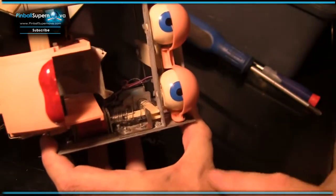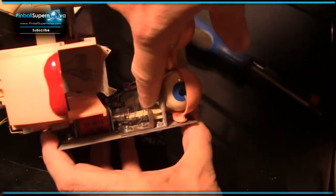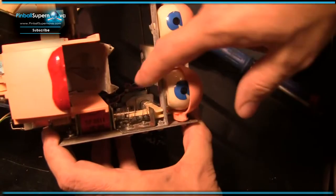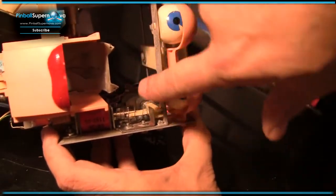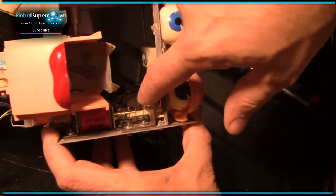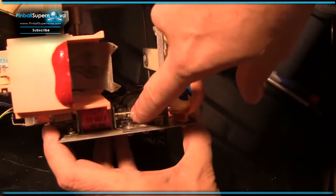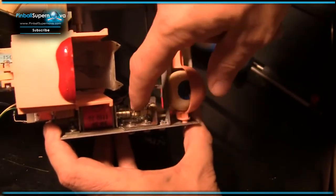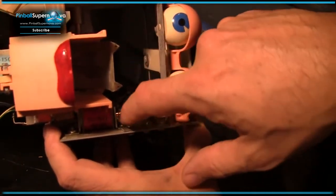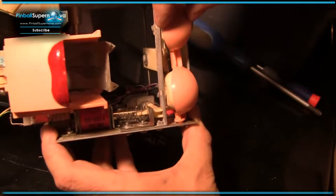And the reason, I think, is you see this spring right here? I think it's inverted. It's turned the wrong way. One end is wider than the other, and the narrow end is over here, and the wide end is over here. It should be the other way around. The wide end should be against the coil, and the tapered end should probably stop right here so that this is pushing up. So you see the spring is not installed properly, and that's causing this thing to not be forced all the way down.